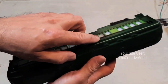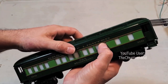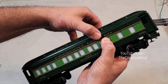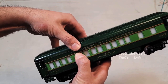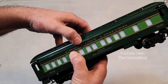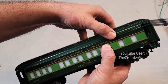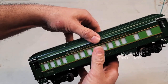There's one clip here and one on the adjacent side. We just squeeze them in and wiggle it like so. Some are going to be hard and some are going to be easy depending on how the car was put together. If you have trouble, you could use your fingernails to pry it off, or a flathead screwdriver with some painter's tape on it to help pry it off, but gently.